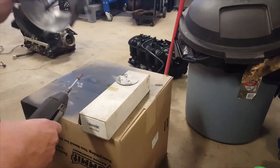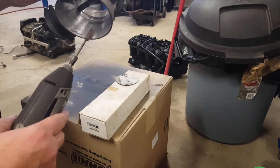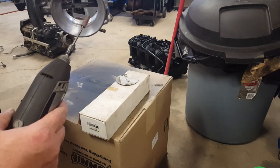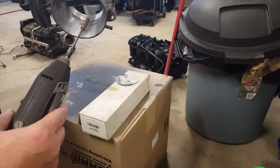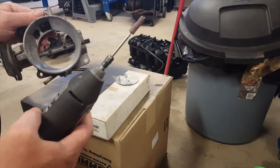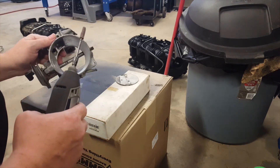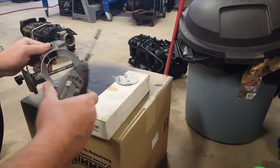We're still slowly going on this - going to go slow. It was very pitted in here. I'm not really a porter, it's not my thing, but I'm just going to keep taking my time. I'm going to try and get this cleared up to the point where we can polish it up and radius it the way we want it to be. I've chosen just to do the small sandpaper rolls for now, just to go slow and keep the shape. I want to keep my shape so it's easier to polish in the end.